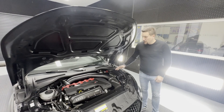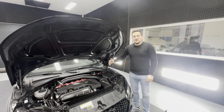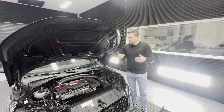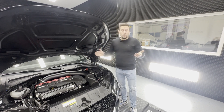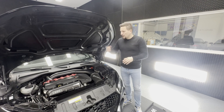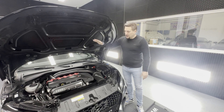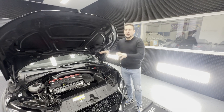Special in this kit is the ability to drive it in the lowest stage with TUV-approved catalysators and have this car street legal for every day driving — for instance in Germany where we have regulations. You can also take the kit and remove the catalysators, switch to the E85 conversion with map switching, and drive on the weekend with this setup around 900 horsepower. This kit is one-by-one identical to our quarter mile race TTRS — there are no secrets, no hidden products.